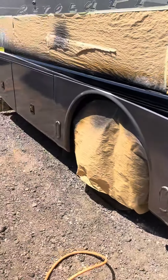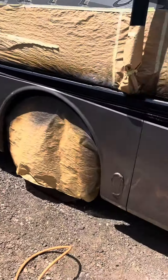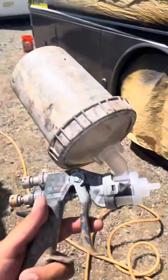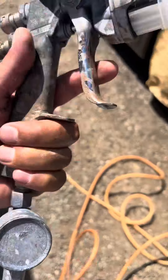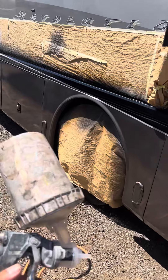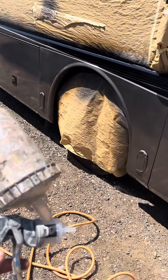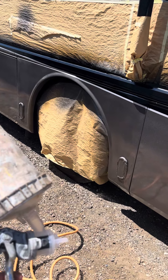So many people are interested in my video about how to spray outside and how to leave it so clean — how come you don't get dust on the vehicle. I told them there are a couple other things I have to mention, so I'll go over it again. First of all, my pressure is set at 20 PSI — usually I do go a little higher, so 20 PSI, maybe lower when I first mix the clear coat.